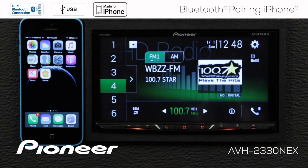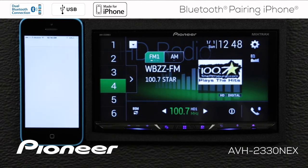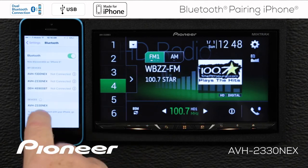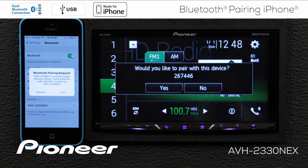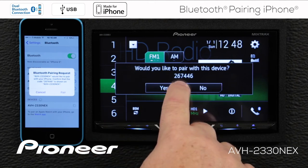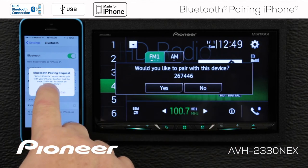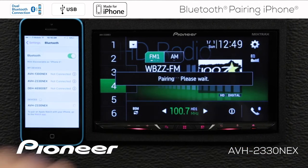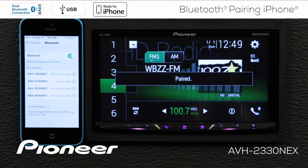Now I'm going to take the parking brake off because I don't need it for this operation. I'm going to touch my settings and go to Bluetooth to make sure Bluetooth is switched on. When we switch it on, it will automatically search for devices. This is the device we're looking for — find your in-dash receiver on the list and touch that one. That will generate a pairing request. Here's the number 267446, and that's the same number on the in-dash receiver. Once we confirm they're the same number, we say pair on the phone and yes on the in-dash receiver, and the two devices will be paired.